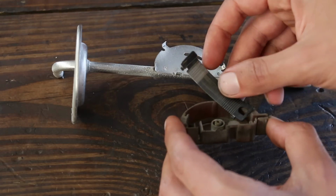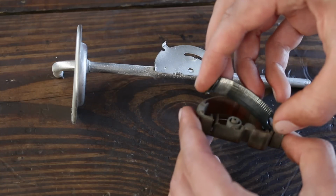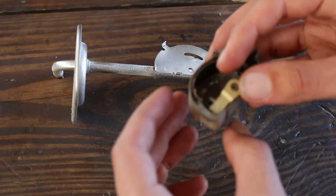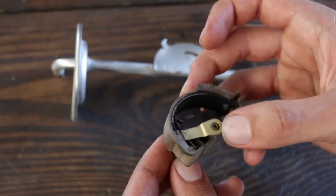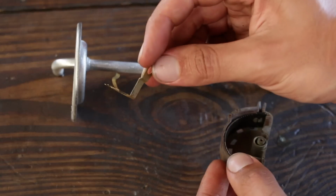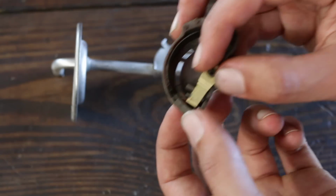This is the resistance coil for the fuel level gauge. Where the wire is tightly wound, it creates high resistance, and where the coil is loose, it has very little resistance. The wire in this coil is in great shape. The fuel level contact brush on the pivoting arm is worn on the end, and it's formed a sharp point that is scratching against the coil. So I'll bend the end of the brush over, so it creates a smooth contact point. The level will read a little lower than it is, but not by much. But at least it won't get caught in the coil or damage the wire.